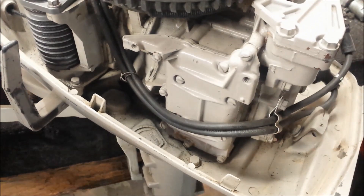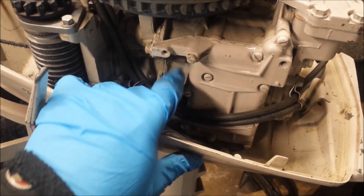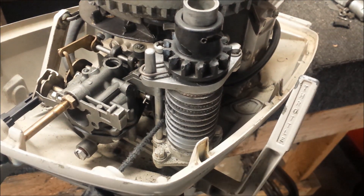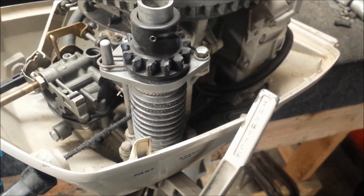It really seems like a five horsepower is just a six horsepower top on a four horsepower bottom — and damn, five horse. Checking part numbers: the cylinder head is the same, the crankcase is the same, the intake manifold is probably the same, and the carburetor looks identical, though I didn't check part numbers on that. All in all, it's very, very similar.